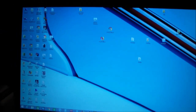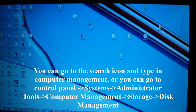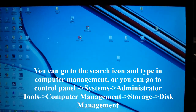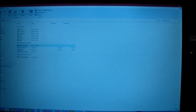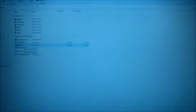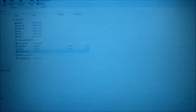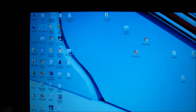I installed the SSD drive on this computer and now I have to go into Computer Management to make the drive show. Because right now it doesn't show — you see C drive, D drive, and E drive. E drive is a DVD-ROM drive. C and D drives are just one one-terabyte hard drive, so obviously you don't see the new SSD. What we have to do is go to Control Panel.